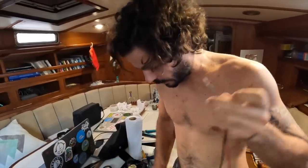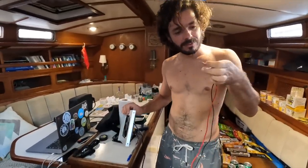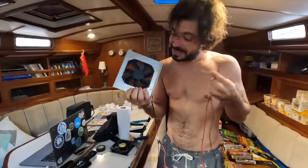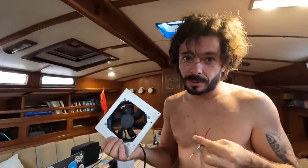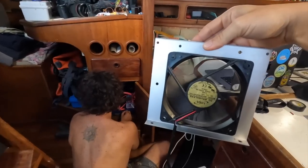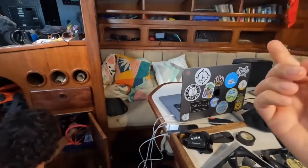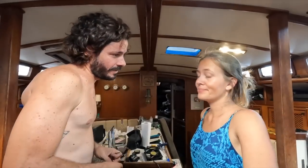It's time for the truth. I'm connecting a long wire to this old fan and putting it directly to the battery to see if it spins. If it spins, that means it's not the problem — it's the first time I want something not to work. Bad news — the fan is not the problem. So maybe the brain of the freezer, the control board, might be the problem.